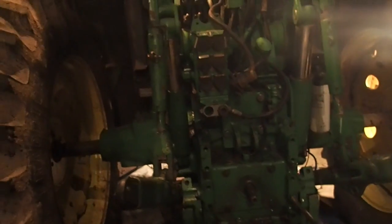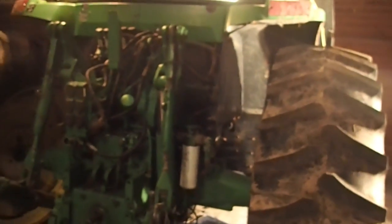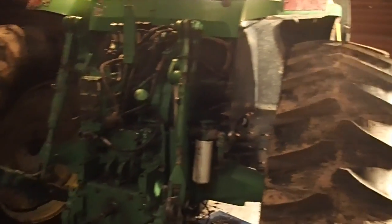Now, when we moved, we turned the discs in the oil with the front part, so we have them actually saturated in hydraulic oil, so we're pretty good there. But what I'm going to do tomorrow, and yes, actually I had the oil level here, but as you can see, the new oil level is down here, so that has worked its way to the front of the transmission, and it is doing its thing by soaking up those plates.